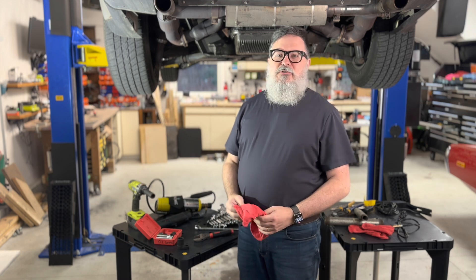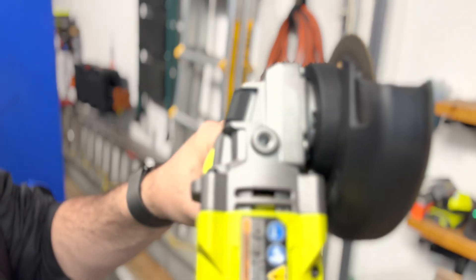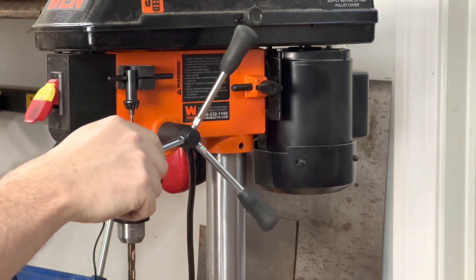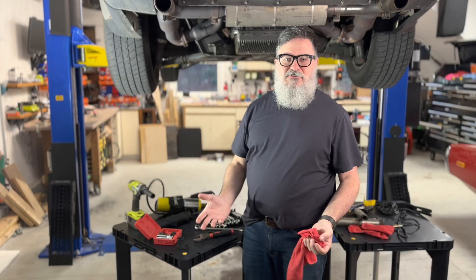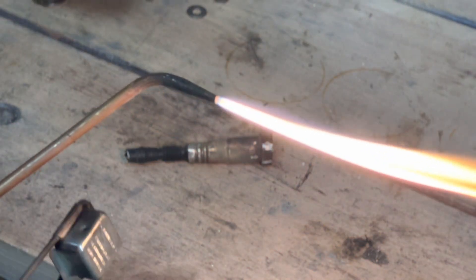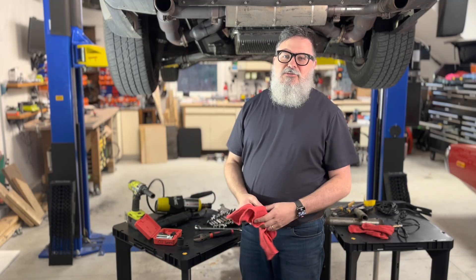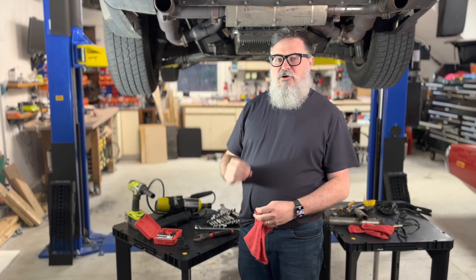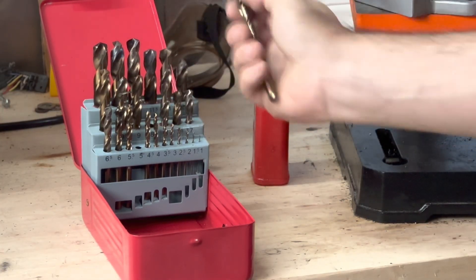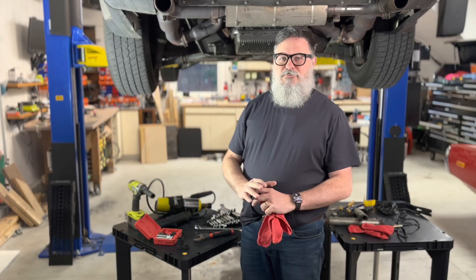I finally resorted to drilling it out. I got the header out of the car so I could cut off the top of the sensor with an angle grinder. I then tried to drill the rest of it out with my drill press, but somehow just melted a drill bit on whatever is inside the sensor. So I stuck the sensor in a vise and tried to melt the internals away with an oxy-acetylene torch. All that did was make a puddle of molten internals I still couldn't get out. So I went back to the drill press, went slower to keep my bits from melting, and was actually able to drill it out with successively larger bits. The last remaining piece I tapped out with a screwdriver so I wouldn't damage the threads any more than I already had.